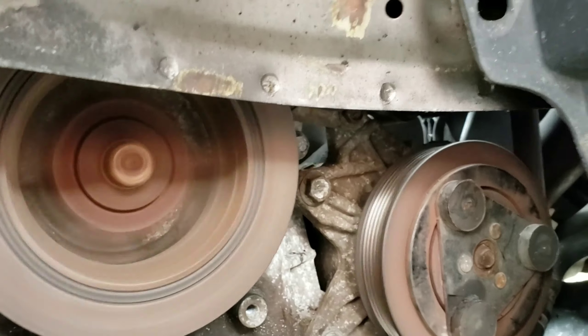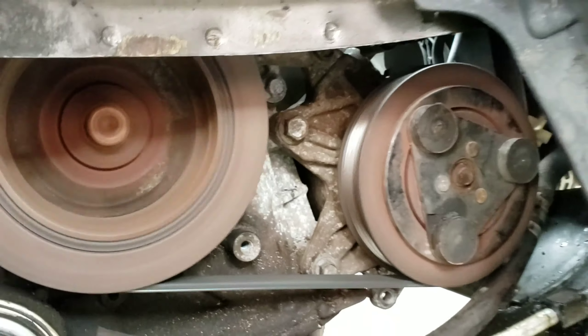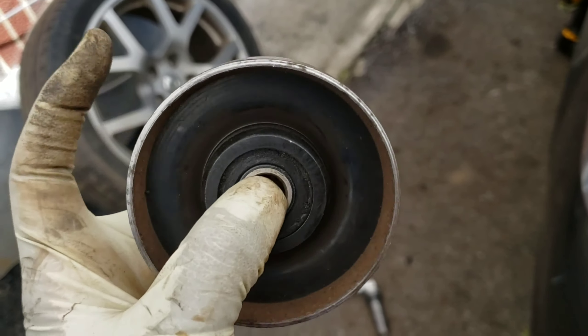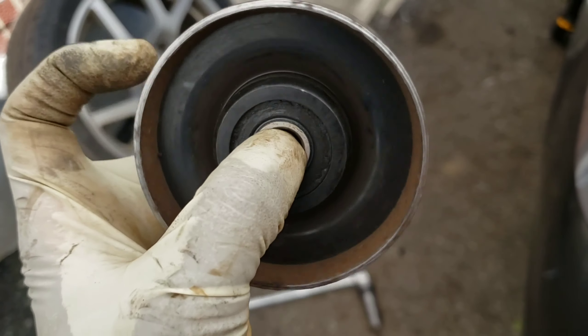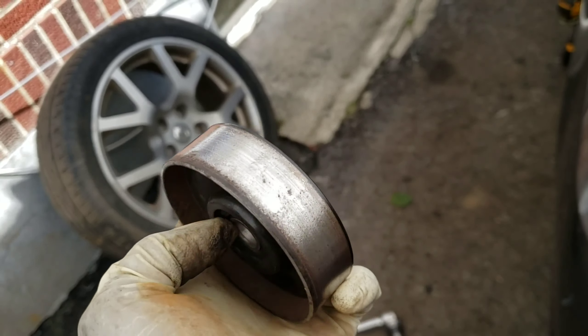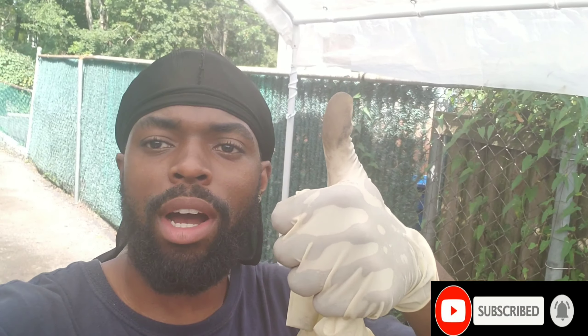Now start it up and see if you hear any noise. As you can hear, there's no noise — which is good. Before, it was screaming. Also, if that bearing goes bad you will hear and feel it when you spin the pulley. This one wasn't that bad but I could feel it in my hands. The shiny pulley is no good — no brainer. That was all for the serpentine belt for the alternator, AC, and crank. If you have any questions, comment below or hit me on Instagram. Don't forget to follow, give me a like if I helped you out, and subscribe.